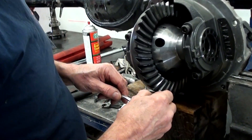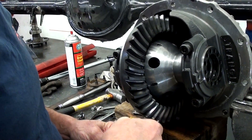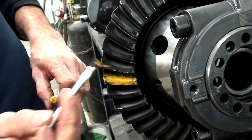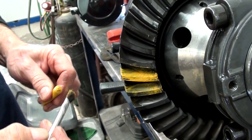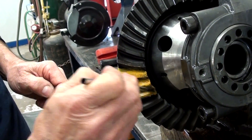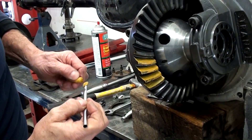That's actually a special pattern grease, basically. That comes with the gear set when you buy them. Yeah, I usually get it, and sometimes we even buy extra. Some people like the blue — brush the tooth over really good. That's so you can mesh it with the pinion and you'll see how deep it's going. Get a good pattern, look for a good strong tooth pattern and make sure we're striking it right. We have to check the coast side too.